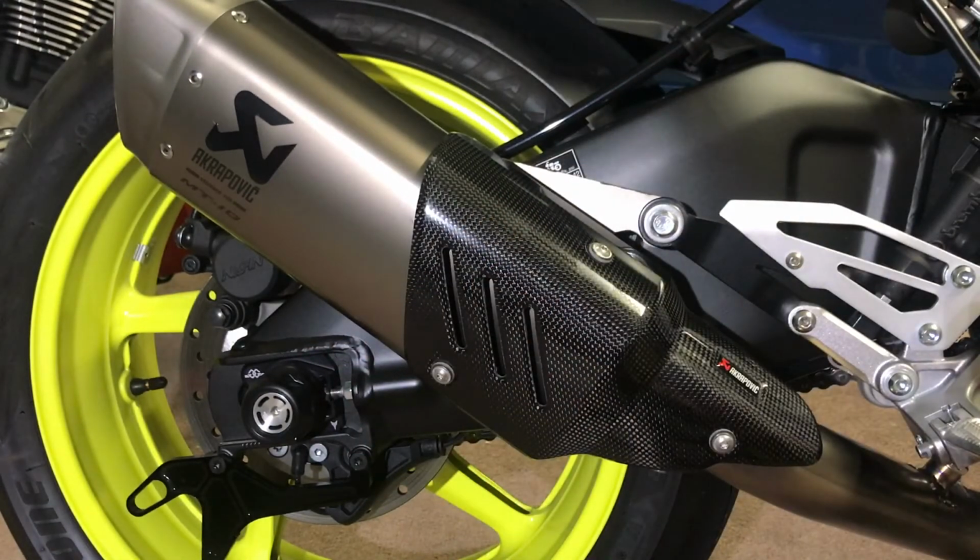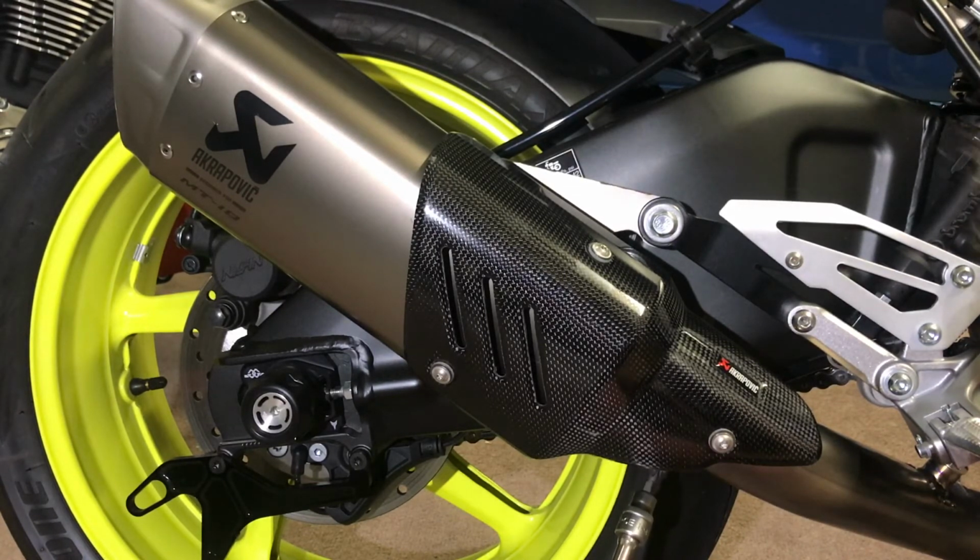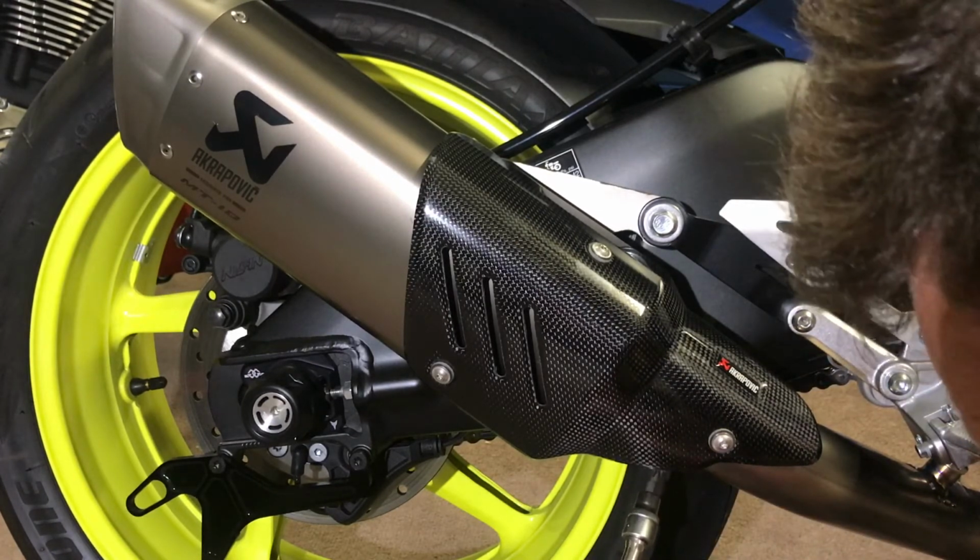That's tight down to its tension, and then we just want to tension the clamp to 14 Newton meters. So we won't use that wrench. This one only goes to 20. We may have to use this wrench. So we'll wind it into 14. There's my lovely dog barking. And let's see if that does it. Yes, that one there. So we'll need to run a couple of different adapters here.